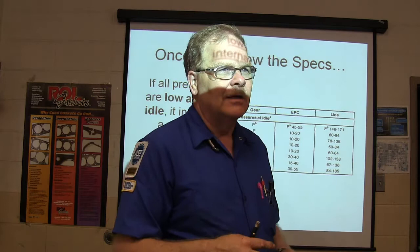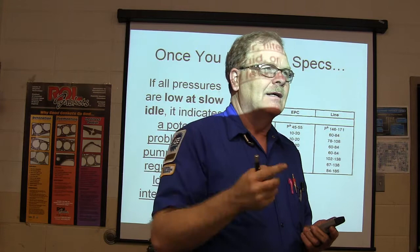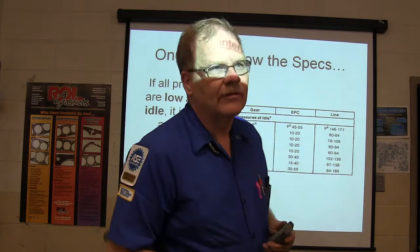Now, the ones that don't have a dipstick, it's tricky. My vehicle, if you went by the book, you would think it had plenty of fluid. You remember when the radiator was leaking transmission fluid, the little O-ring? I took that little center plug and it was dripping out of there with the engine running and the transmission warm. I said, well, according to the book, it's got plenty of fluid in it. But it would actually do crazy stuff sometimes because it was too low. So I put another quart of fluid in it and it was okay. It had been leaking for a long time before I even realized it.